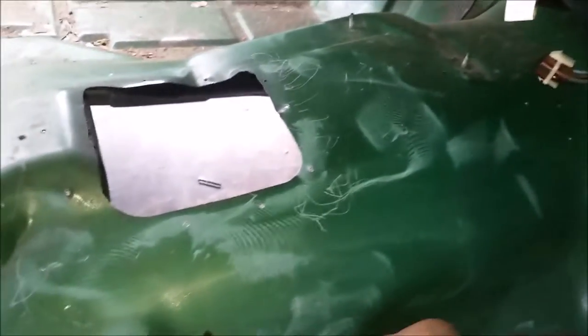So, I'm going through here, and I'm wire wheeling like I am, and I'm trying to get, let me walk to the other side here, I'm trying to get as much surface area at least lightly touched, and then wire wheeling the rust away thoroughly, because I want to paint the entire floor, hopefully, and it's going to be a carpeted floor, so it's not like you'll see these scratches through the paint when everything's said and done. So, I'm just trying to give it some texture so the paint has something to grab.